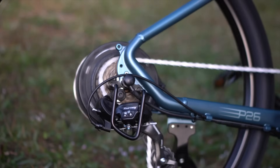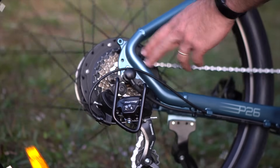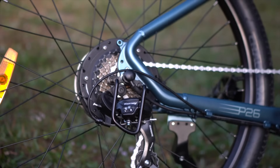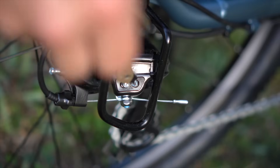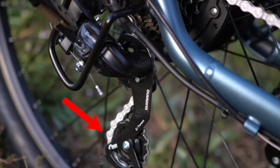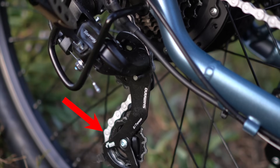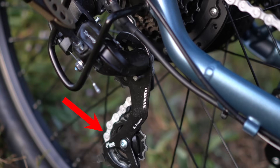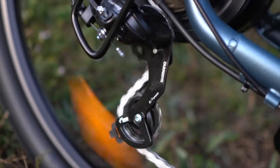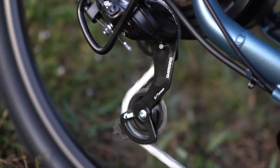Now let's shift down into the highest gear, which is that smallest ring there. When you shift down, if you notice that your chain tends to jump in between the frame and the gear, that means your high gear stop is not correctly adjusted. Come in here and adjust that bolt — you can actually see the derailleur move as I turn this, that's adjusting the limit. Back it out to where it's perfectly in line with that last gear ring. Now you can see I've got it back in line and my chain is not jumping at all.